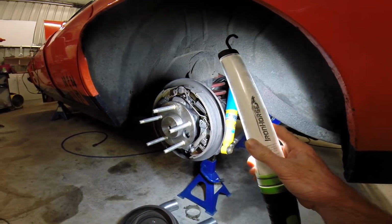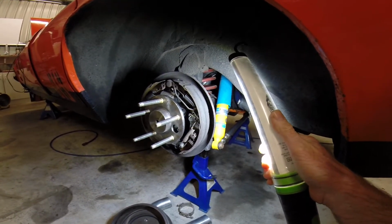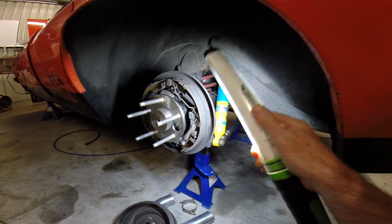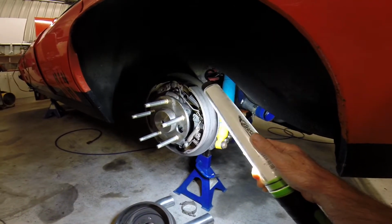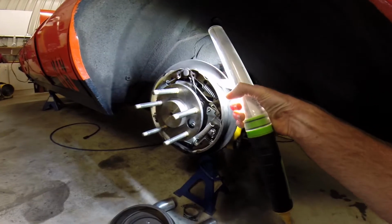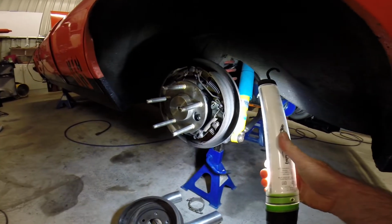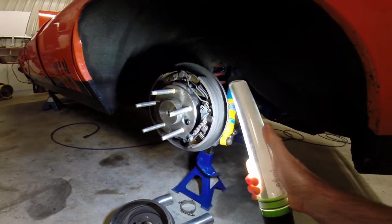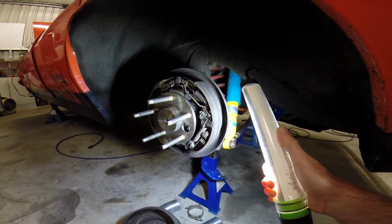As far as I know, he's doing around 10 to 12 laps. And for drums to hold out like that with a bit of water on them is a testament to them, really, because the biggest thing is the heat. If you can get some airflow inside of them and expel that heat, they are an awesome brake, guys. Don't ever write these things off, because you've got such a huge surface area of a shoe on both sides, so you're going to pull up like nothing else. But the trouble with them is the heat. And if you can't get rid of that heat, well, that's the end of them. They're all over Red Rover.